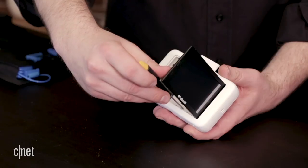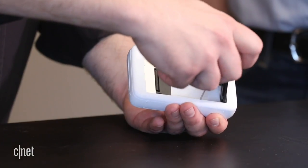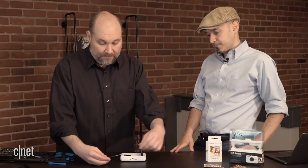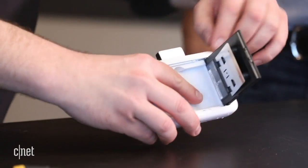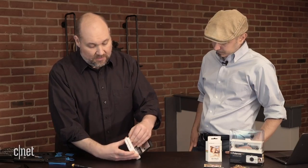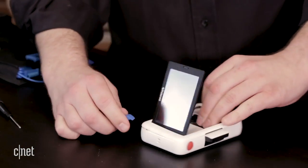There's one small screw — luckily this is a Phillips, just a regular Phillips, very small, so this is a double zero or triple zero screwdriver. You can remove this small screw like that, and once that comes out, we can actually remove this plastic housing, this part of the plastic housing. We're going to start around here, and luckily it's just going to pop open. We're going to be real gentle with the plastic — you can kind of see it's already started to loosen there.